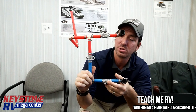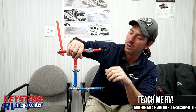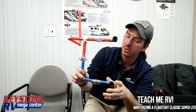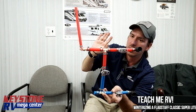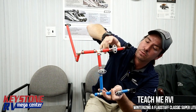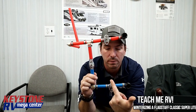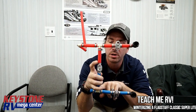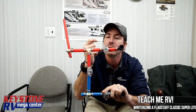This is the backside of the hot water heater. These two black pieces here are what's going into the hot water heater — the red is going to be the hot side, the blue is going to be the cold. During normal operation, water comes in, goes into the hot water heater, gets heated up, comes out, and goes to the rest of the trailer. To bypass it for winterization mode, turn all the valves from their current position. This will apply whether it's a two-valve, three-valve, or single valve — doesn't matter. So what we've done is shut the water off — the position of the handle shows the position of the valve. The water coming in now gets stopped right here and is allowed to come up this way. It tries to cheat its way back into the hot water heater but is stopped right there, then continues on the rest of the way. When you're winterizing, it's pumped in, comes up, and winterizes the rest of the lines without filling the hot water heater.